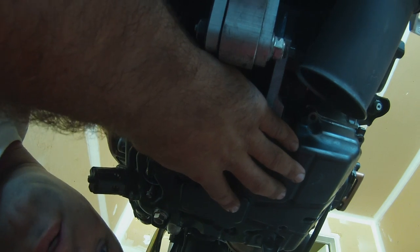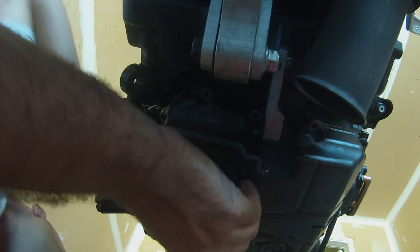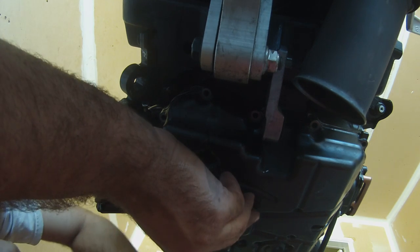That lined right up nicely. So put the oil pan pin in first. And this thing will, or the weep hole pin, put it up in the water pump first, and this oil pan will line right up. That made it very, very easy. On the first and last turn.